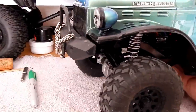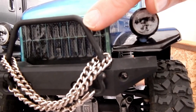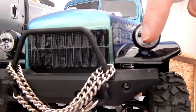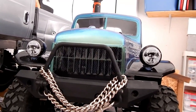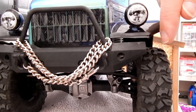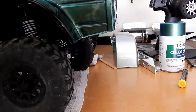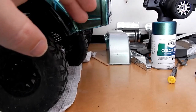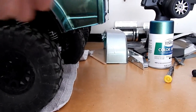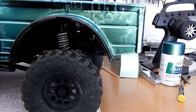The other thing we did to the truck is on the front end — I cut the loop that goes across the headlight on the FJ Cruiser body because it didn't line up with the truck's headlights. I need to smooth them out a little more, but the stock HPI bumper looks pretty good with the Power Wagon body. It almost comes out to where the fender starts curving back. The back bumper, however, does not work with the body at all. The body just hangs out too far out the back. The whole bumper only gets about even with the back of the bed, and I'd have to cut so much material off the bed to clear the bumper, or chop the bumper to bits to get it to fit. So the wife decided we'll just leave it alone and leave it for the Cruiser body.